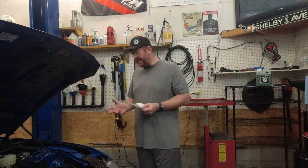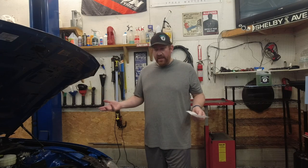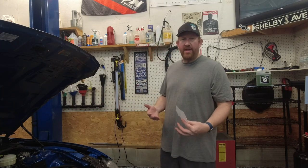I don't know what power it's making — I haven't had a chance to put it on the dyno yet, hopefully that's coming. But to me a dyno is just a tool — dyno numbers don't really mean anything on their own. Automatics are going to dyno lower, manuals are going to dyno higher, but at the track an automatic is going to destroy a manual. So the dyno doesn't tell you much by itself; it's useful as a comparison tool between a previous tune and a new tune, or before and after a build change — as long as you use the same dyno under the same conditions.